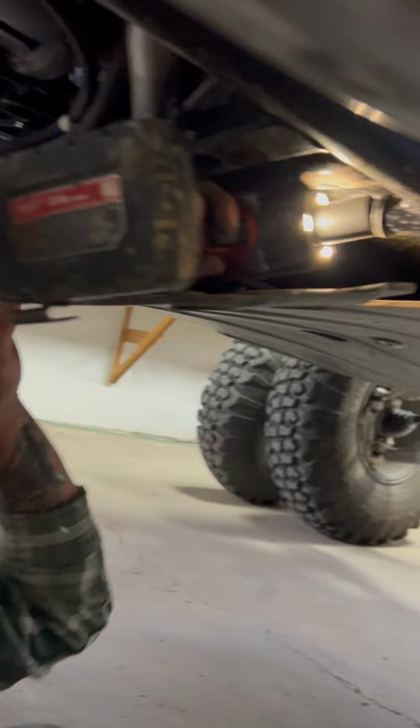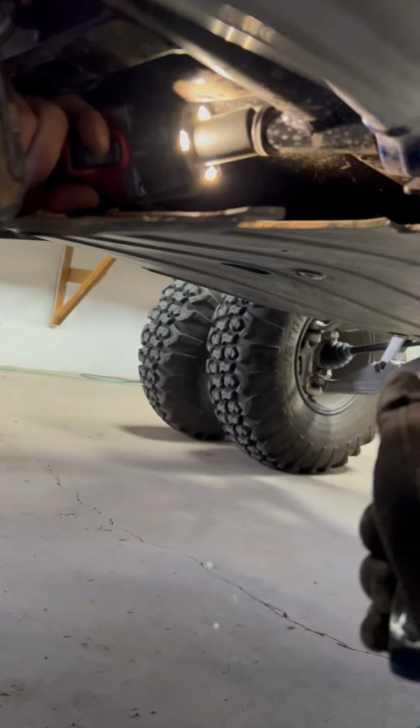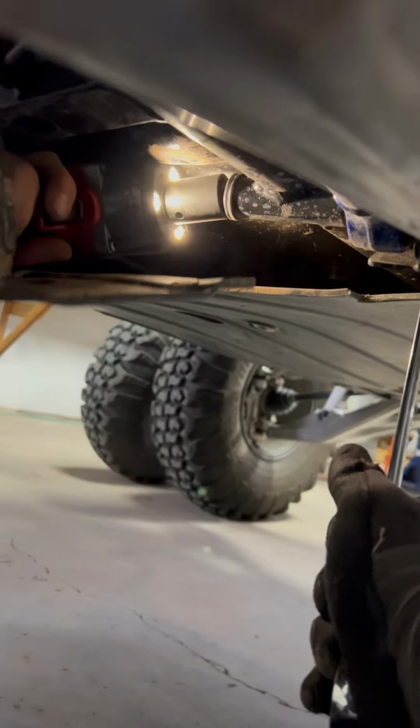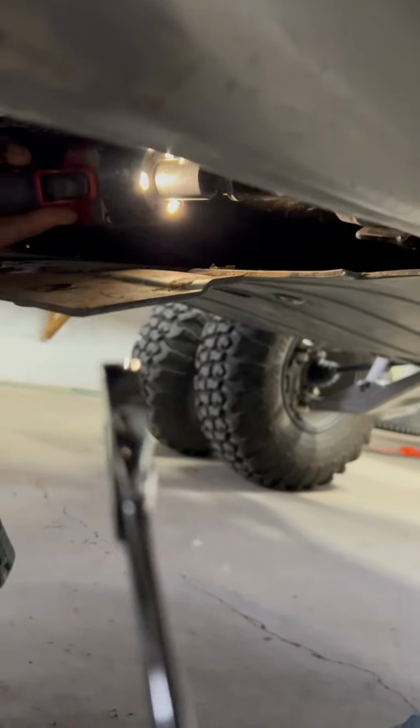I'll stick my wrench in. If you just peel that skid plate back a little like Brian did, take off the back one, and then there's two smaller skid plates right here. It's a T40 to take those off. And he's going to take that off. We think so. Never mind. Probably going to need an extension.